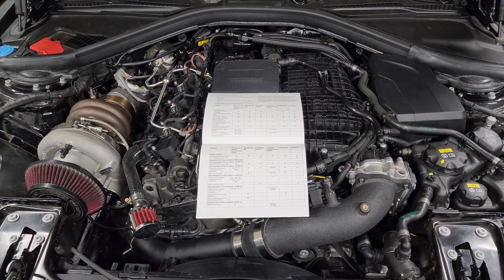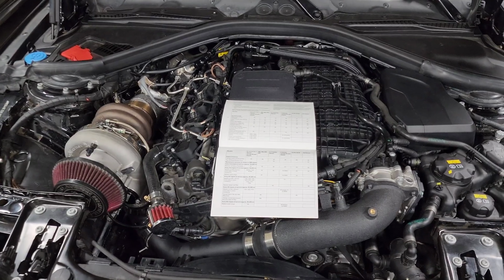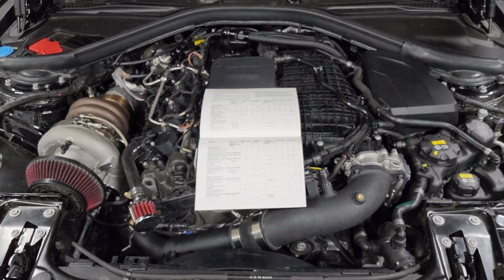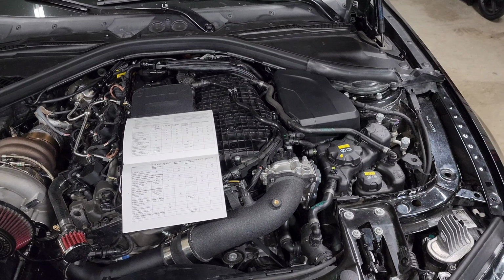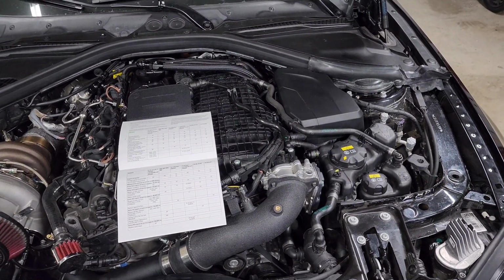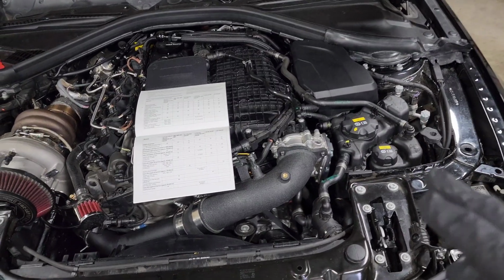Now, besides that, you can do the whole 100-point inspection, like what BMW does. Basically just go through your car and check for any wearables and consumables so that you know if something needs to be replaced. So go check out your brake discs and your brake pads. Those have minimum thicknesses, so if it goes below that minimum thickness, it's time to either replace your rotors or your pads. Check your coolant levels.